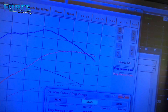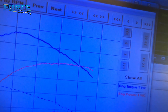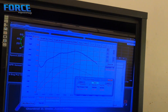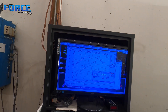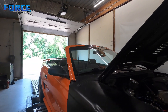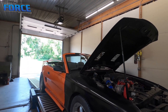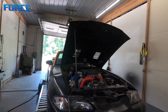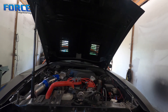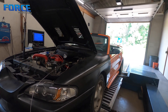It still doesn't make power really late — it really needs more camshaft, it's all out of steam. I turned it to 5,600 RPM; you can see how bad the torque curve falls off up there. I actually think this thing might benefit from a little bigger throttle body — although it does have a BBK throttle body on it currently — but it was never quite reaching 100% atmospheric pressure even at full throttle. So that's definitely some of that power fall-off, but I think it needs a little more camshaft and to rev this thing a bit harder.